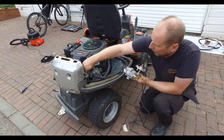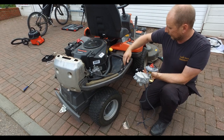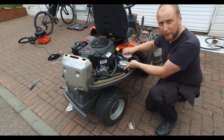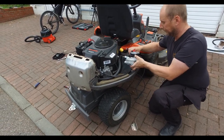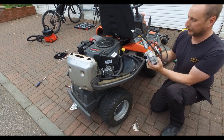So we've got our carb all linked up now, the gas delivery pipe from the regulator clipped on with a P-clip there. We're going to mount the regulator just inside there. So we're going to mount a bracket and try and get that fixed in. It needs a 12-volt source, so luckily we've got one just directly in front of it there. We'll pop that one on now.